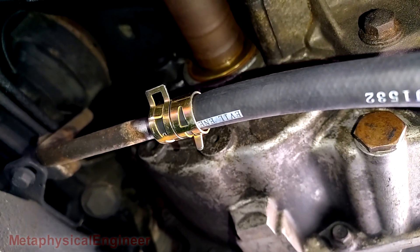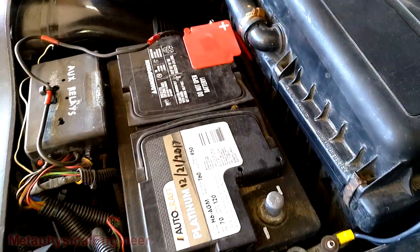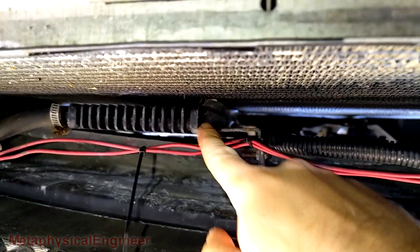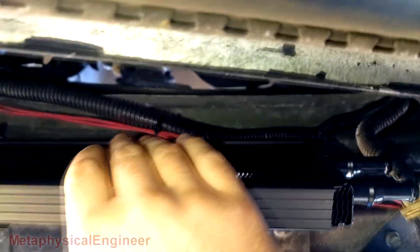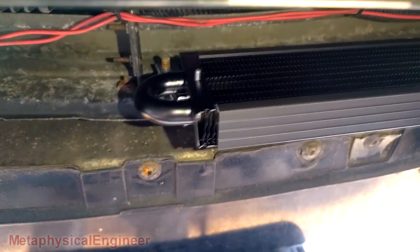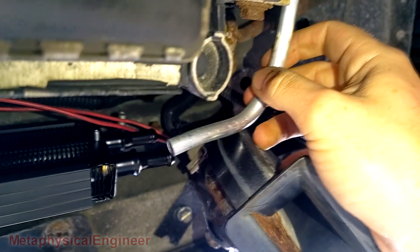Still double clamping it, just to make sure that joint does not blow open, even though it's stiff enough it could probably stay together even without the clamps. Good idea to unhook the battery negative — the steering pipes go right past the starter, and that's the kind of excitement you really don't want to have. Planning out where I want the cooler to go. The front bumper support has a few holes; one already has a bolt and bracket for the transmission cooler. There's a matching hole right over here that I could use to support the far end of the steering cooler, so that could live somewhere like that. Hardware looks like it's going to work, and we'll have to adjust the position of this horn and trim the pipe a little bit, but should be able to make that work.